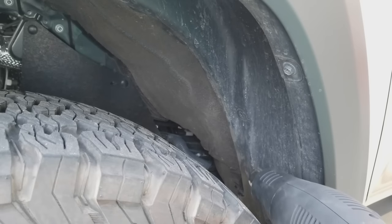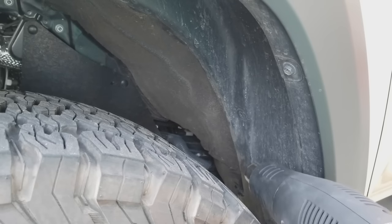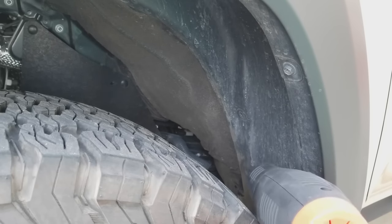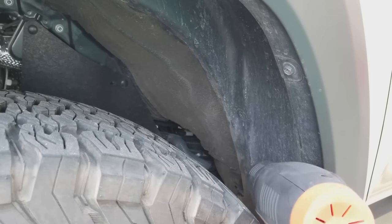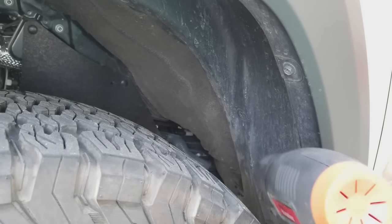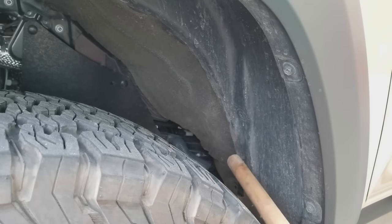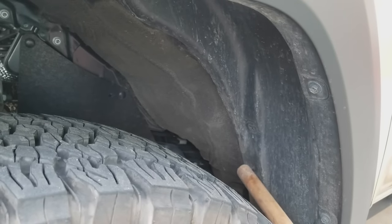Usually when I do the trim, I'll turn the wheel to have more room. But since I'm just using the heat gun, I want to use my tire as leverage in a corner so I can push everything in a little bit more. So I went ahead and kept it straight. So we're heating up the area. Then wear your gloves, which I should have. Let's see if we got this heated enough. I couldn't find a smaller stick — I want a shorter stick, but this will still do. I'm just trying to make sure I don't hit the camera. Let's move it a little bit. You can see how malleable it became.